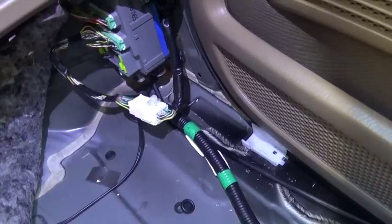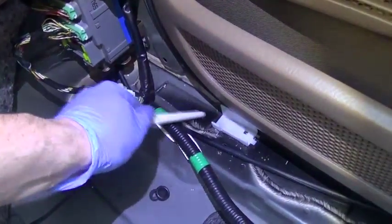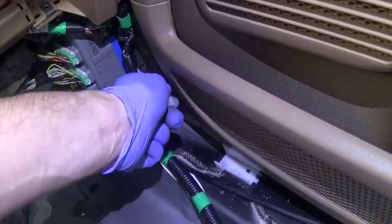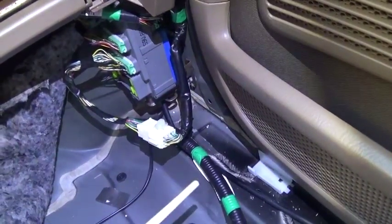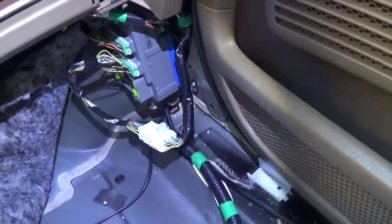This whole place here is full of water actually. I'm not sure how the water is getting into it — if you look right there, you can see that's the water. I'm moving the car a little bit. So now the question is how the water gets in — I need to investigate some more. Okay, I think I found the source of the leak. We can see the water in here again — it's coming from this hole here behind the fuse box. If you have this problem, you're going to spend some time fixing this, so I'll show you what the problem is.